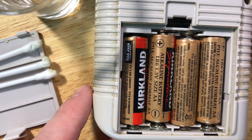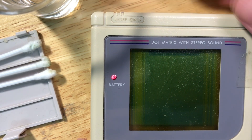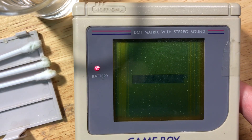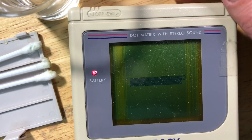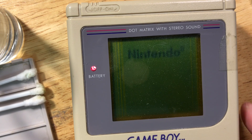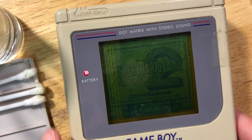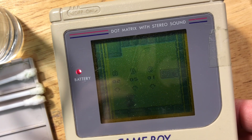Alright, I've let it dry up for a little while here and now I've put a fresh set of batteries in. Let's see what happens now. Well, success — I've restored the battery power. Again, I don't expect it to say Nintendo; that's kind of its lockout mechanism showing that there isn't a cartridge in there. So the mission today of getting the battery compartment all cleared up and ready to go was a success. Alright, one more time now with Super Mario Land 2 in here. We see Nintendo — so it is reading the cartridge! The lines here are a different issue altogether, but something I may be able to try and look at; otherwise a straight-up screen replacement might be in order. Maybe something that's backlit — there are plenty of options today — but for now, pretty sweet that this is working again.